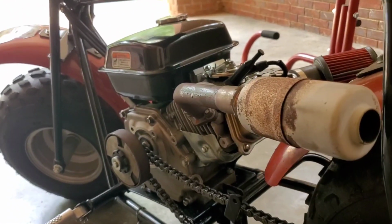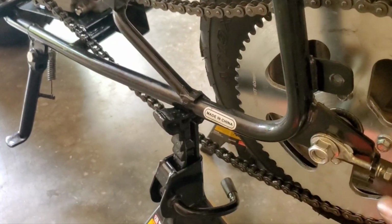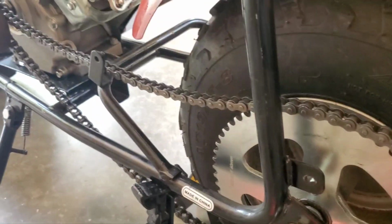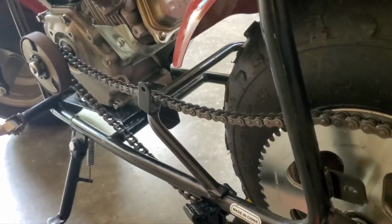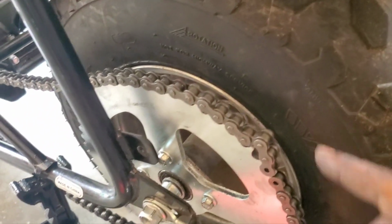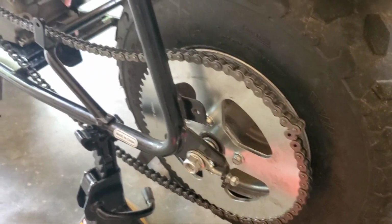Okay, I got my chain on there. It's a little slack on it right now, but I got it all the way to the front so I can add tension on it by twisting these little bad boys in. So I'm gonna add the master link back on. It took forever to add. I hate dealing with chains, but it took forever just to make this long chain. All I had to do was add five more links to whatever I had.